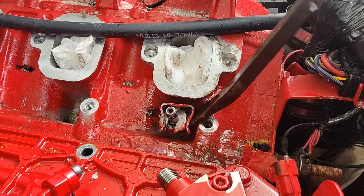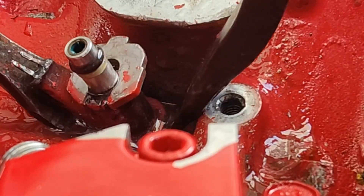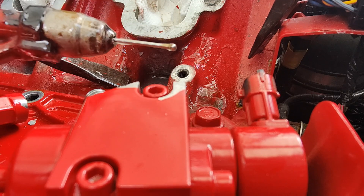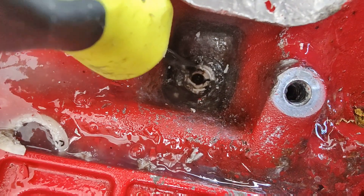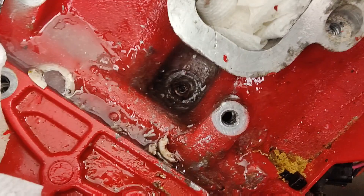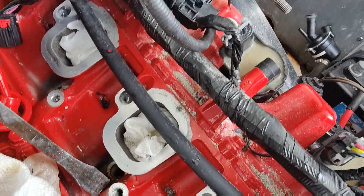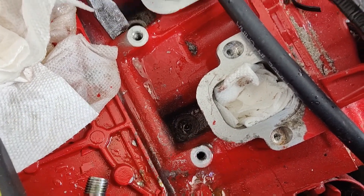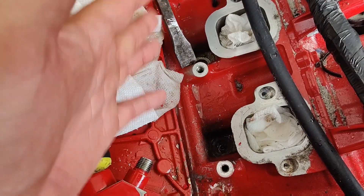But now she's still stuck in the head, and we broke the little end off it. This little metal piece is what was holding on. We'll try to pop this off and get some pry bars underneath. Hopefully this bastard will come out because she's definitely stuck. It was only moving on the rail side. Oh, there she goes — finally felt it. And it's broken. It's so corroded that it broke off. Well, that's going to be fun. I'm hoping it doesn't fall in the hole. We got some gasket on the outside here — you can see all this corrosion. After all that struggle we broke off this tip in the head. I don't think it was going to come out of there anyways, looking at that corrosion in the hole. After talking to the boss, we need to pull this head off — which we're not going to do right now, but the head's going to come off. We can take a look at the other side, clean it up real good, and make sure we don't need to send it to a machine shop to redo this hole, because it could be pitted enough where it's going to keep leaking. So we're going to get this head off and come back to this project.